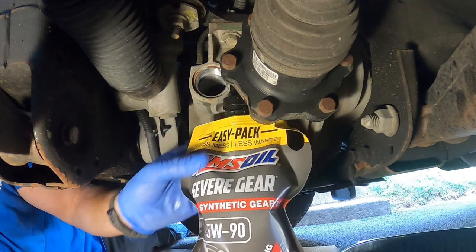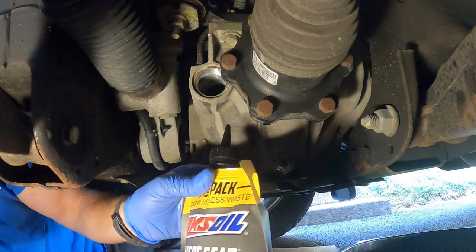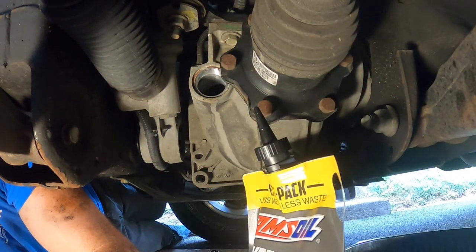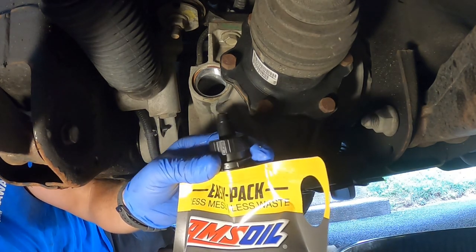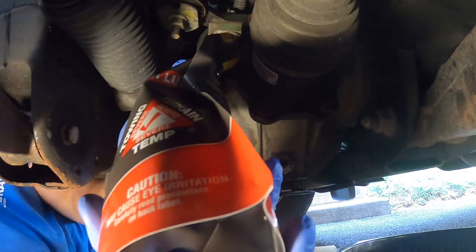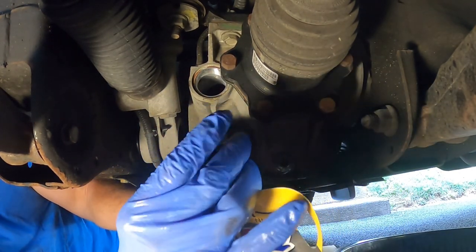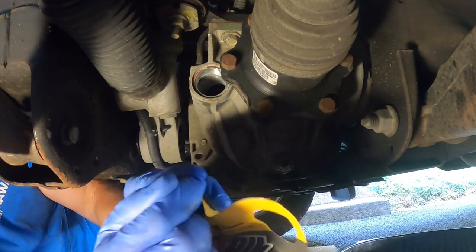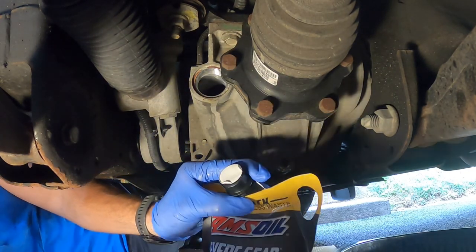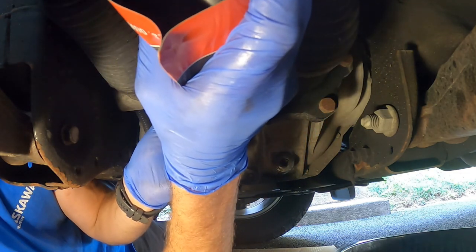It's the 75W90 — that's manufacturer's spec. These packs are pretty nice; you have the squeeze so I can just turn it. I don't have to have any hoses or anything like that. I'm going to chop this top off and we'll start filling it up. I'm pretty sure this should take two quarts. I'm going to open it up — don't forget that — and now we'll start filling it up.